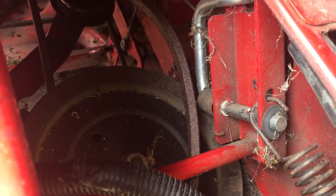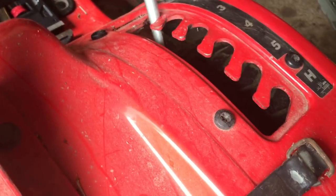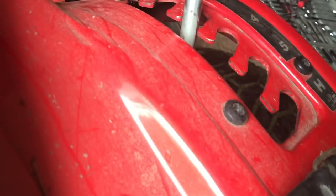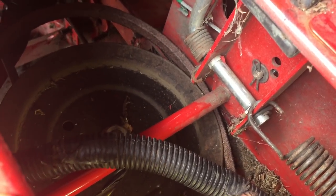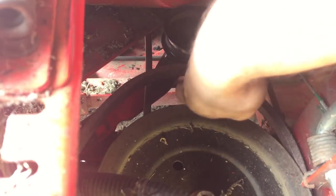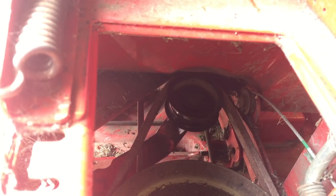I'm also replacing the transmission belt that goes on the top portion of this pulley. In order to get the transmission belt into place, this piece needs to be flat and level. I'm going to raise the deck, and by doing that the piece down here is now flat and I can move the belt in between it and the pulley. The last part is to get this belt onto the pulley right here — if you pull this arm towards you, you'll be able to get the belt onto the back side of the pulley. And there we go — the belt is on the back side of the pulley.